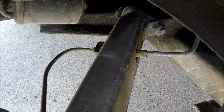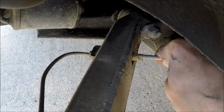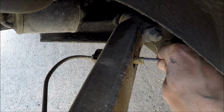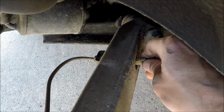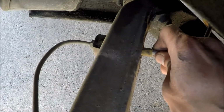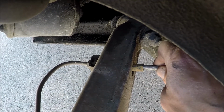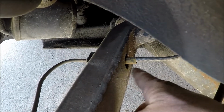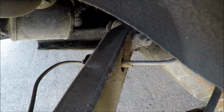Flange on the inside of the boxing to hold the flexible side of the brake line so that the hard line can be wrenched in place without this side spinning. Usually you can get at the back side with a wrench, but you can't because the boxing is there, so we'll put a piece in to make that work.